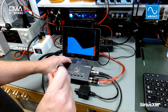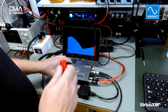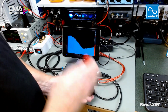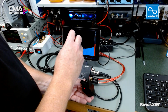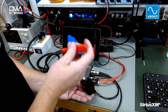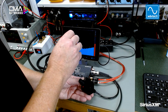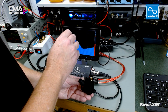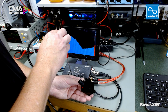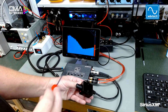So the settings that you'll have here will be somewhat different than you would have had fixing a factory roll-off or a signal that didn't have all that much bass to begin with, because you've already got quite a bit of bass. But we can just turn the effect on and off, and you're going to want to set this for your music taste. Like I said before, the frequencies that you're going to want are what's most effective in your subwoofer system. You might want to set the frequency a little bit lower, a little bit more narrow if you want that real low bass impact. And then you can just set the effect as high or as low as you want. And just keep in mind, protect your subwoofer always with the subsonic adjusted as needed.